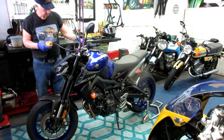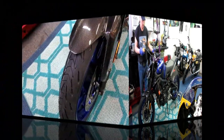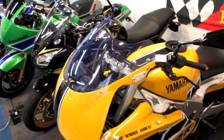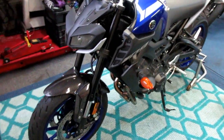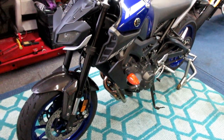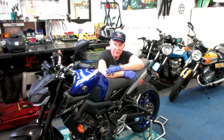That's a nice install. Something to really think about: if you want more performance, people's first instinct is a louder muffler or different header to gain two or three horsepower. But in reality the real performance gain is always in the tires. A fresh set of tires that aren't squared off, aren't wonky, and are at the right pressure for your riding style — that's the best value in motorcycling.